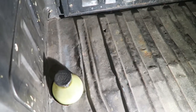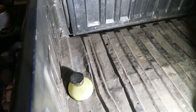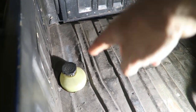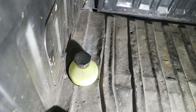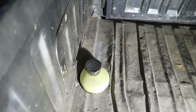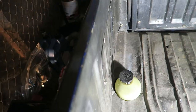Unfortunately the pump is not in the best place — it's a Holden Astra power steering pump and the top is sticking out of the rear tray because it's too tall. If this setup works straight away, that pump is going out. I'll cover the hole and get an aftermarket electric power steering pump — they're a bit flatter and I can probably find a small one and mount it somewhere hidden away.